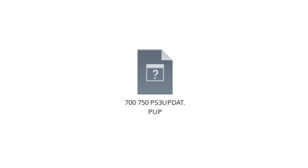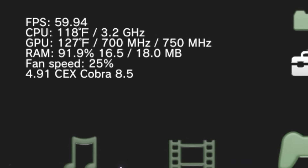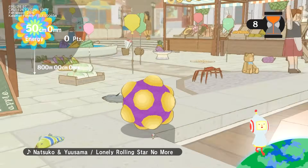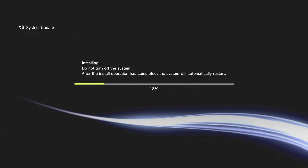I've got another firmware here, also from the PSX Place thread, that boosts the RSX clock speed by an additional 100MHz. So I'll be running the RSX at 700MHz, and the video memory at the same 750MHz. I went through the process of updating the firmware again, and after a reboot, the RSX now reports a clock speed of 700MHz. On the third round of tests, I loaded into a level in Katamari Forever and was hit almost immediately with graphical artifacting. I cut the test short at this point, because this is a sign that the overclock is becoming unstable, and I don't want to risk damaging this console.